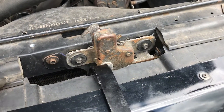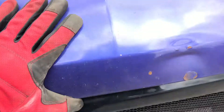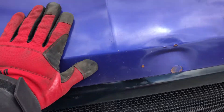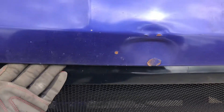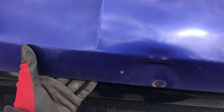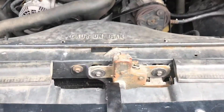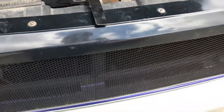Here's what you're going to do: close your hood, engage the secondary latch mechanism so it pops up, then slide your hand under there and find the latch — I have it right there at my fingertips. Normally you place your hand right here and give it some slight downward pressure to take the pressure off that hook. So: downward pressure off, slide the latch over, and bingo — you've just opened your hood without having to reach down to the grill or climb underneath.